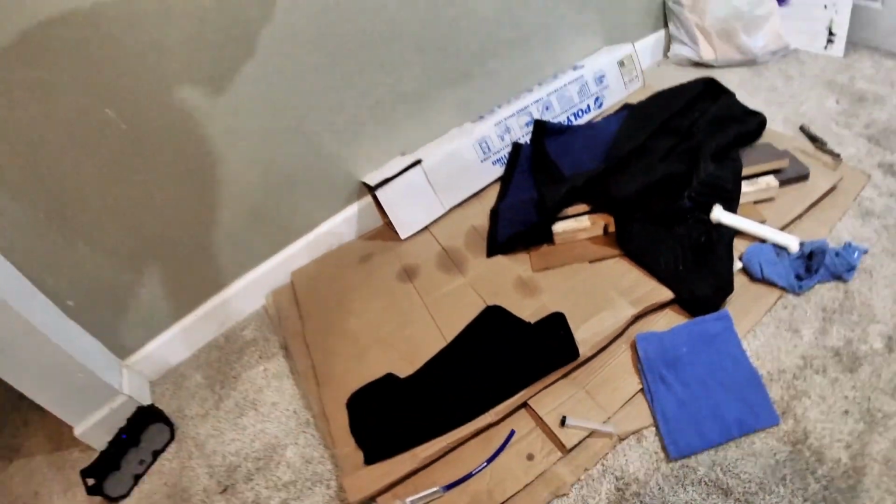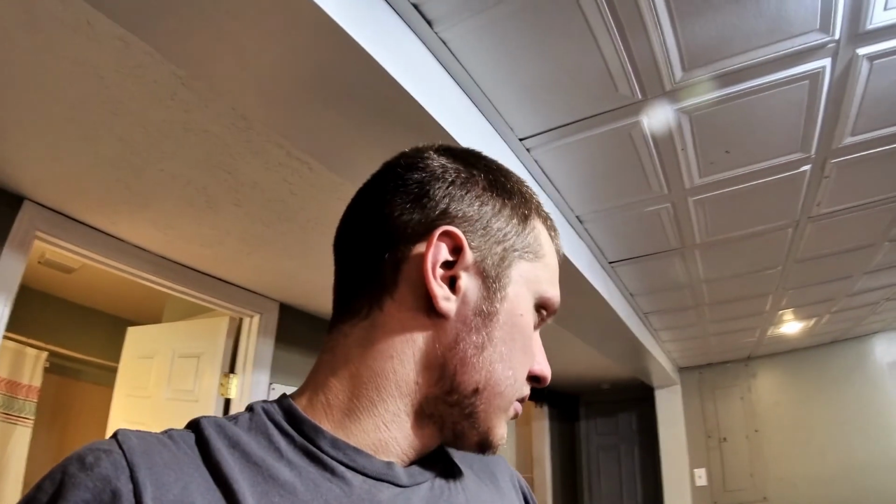So, once you have your clear brake fluid flushed, then what I'm going to do is I have a syringe and a little dropper over here, this guy. This and this, and I'm going to suck out all of the brake fluid I can out of this reservoir. Then I'm going to top the reservoir off with the Motul fancy stuff.